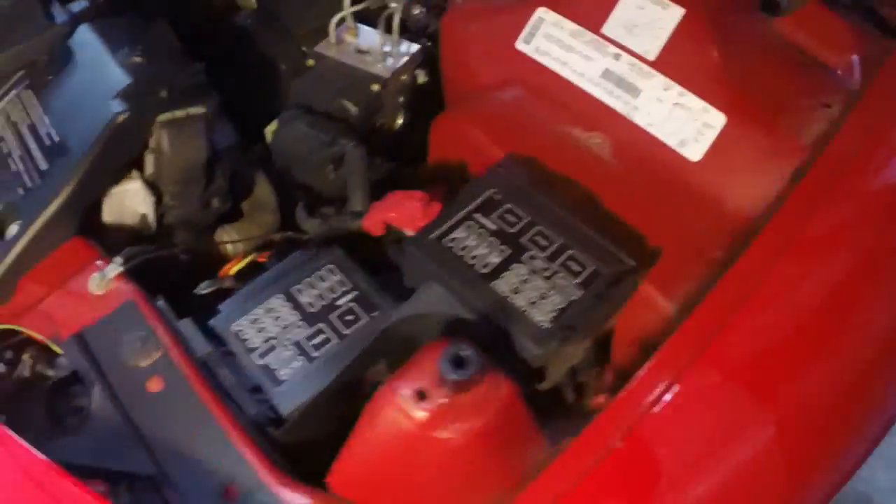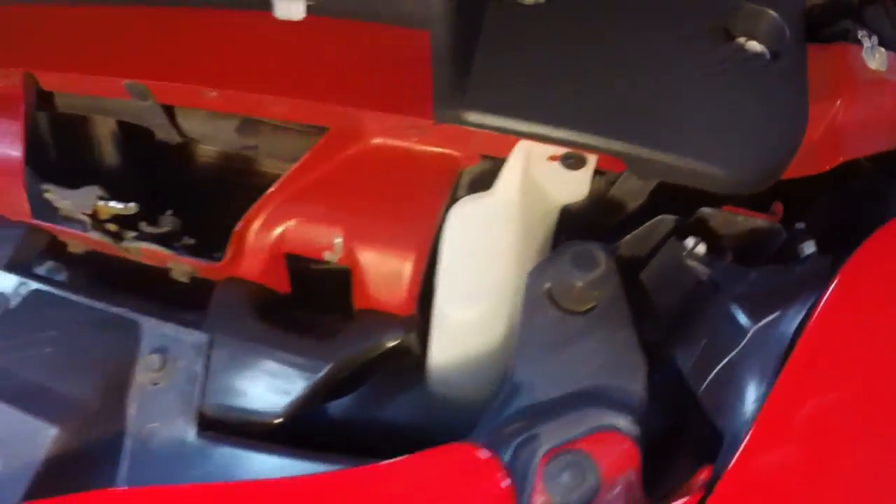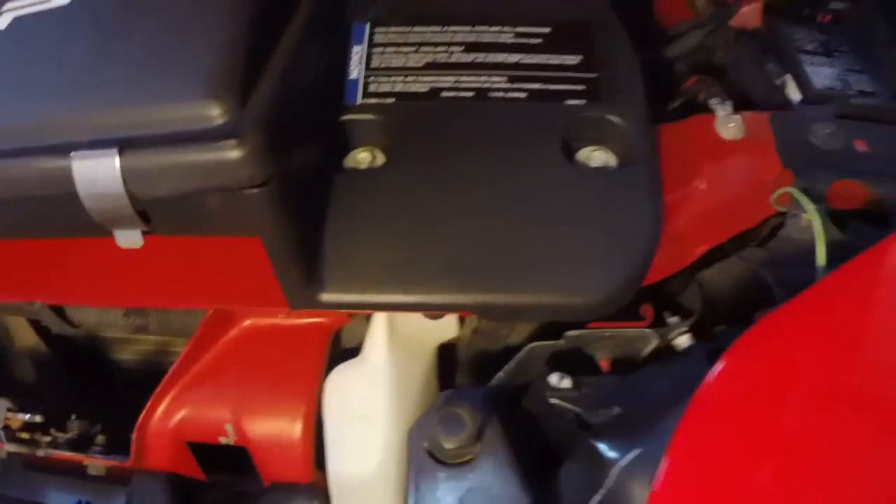For the driver's side, same thing — make sure you put your three seven millimeter screws that hold it in, your three threaded inserts on the bottom side, and the two 10 millimeters in the front. I'd also suggest — as you can see the hood opener sheath is up above — before you put it all back together, make sure you test the hood and make sure everything opens. All I did was move it to the bottom side, put it right back through the same spot, and hooked it back up. I tested that everything is working properly.